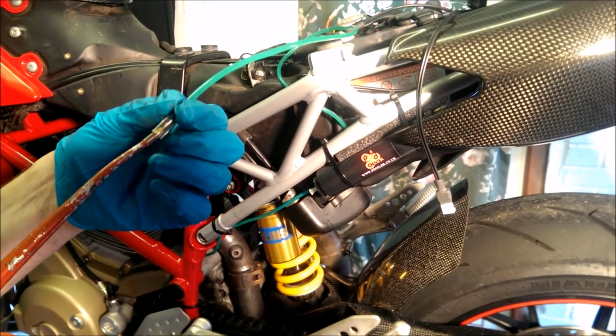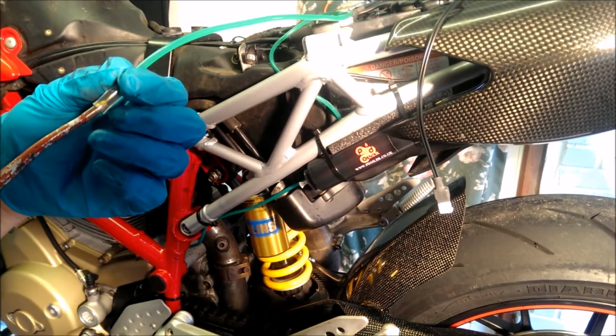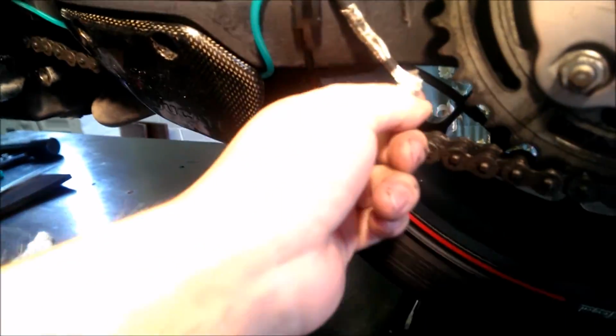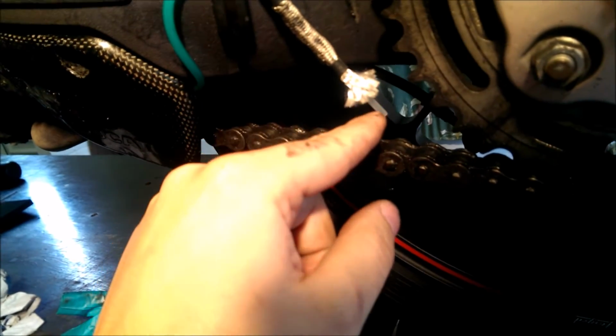What we're about to do is prime the tube before connecting it to the oiler. This is paramount to do, because the oil will travel all the way down to the bottom. You'll see it come out the bottom of the tube, so obviously pull the wick up and you'll see it coming out the bottom in a minute.